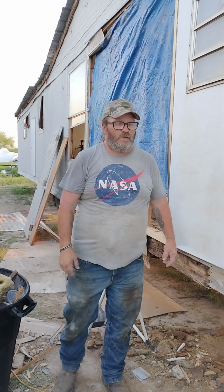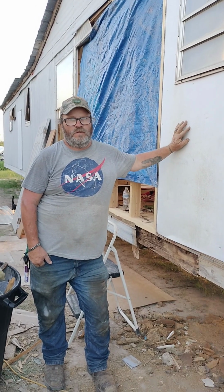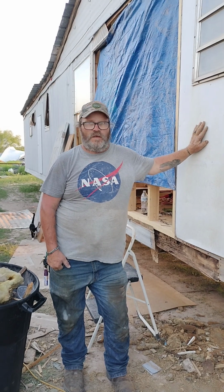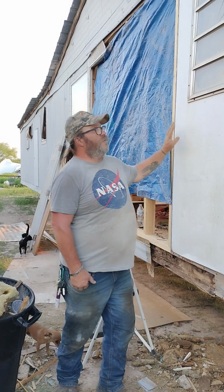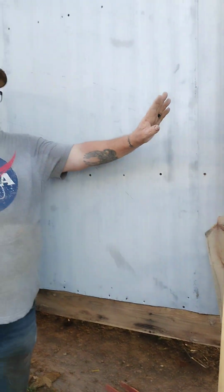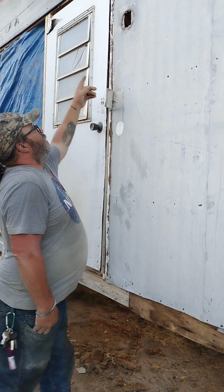So today, I decided I wasn't going to drive today or this next week because this has to be done, because we've got some stuff going on for changing up. This trailer was a gift to us, and it had some exterior damage to this wall here. Now I had to take the tin back, clear back to this panel here. I had to take this panel and this panel off to repair the floor and part of the wall studs in here, and to resurface the door.